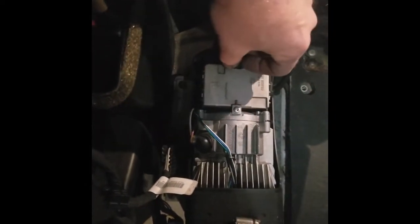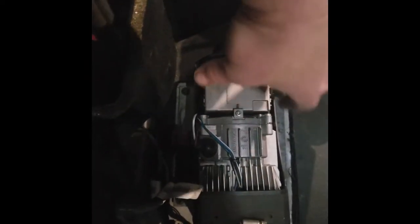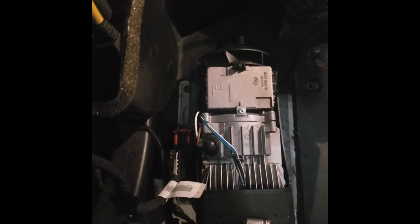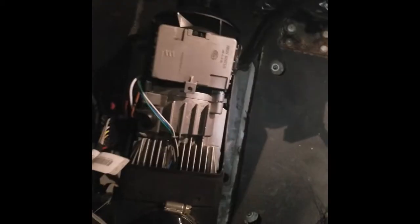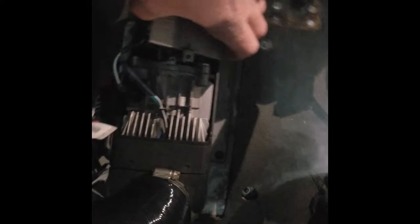I'm going to lift this out and I'll come back once I've got that done. Just remember, when you're pinching this and lifting it out, there's a bunch of connections under there, so you want to not jerk it out. I got the screw off and I pinched it out — it's clear now. In the back there's a rubber grommet that slides into the keyway, so you're going to want to slide that out and then you get some play.